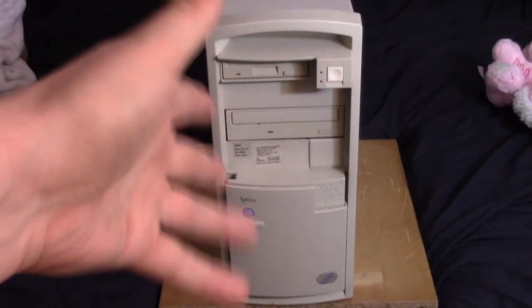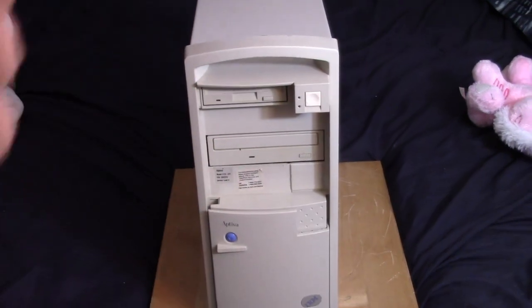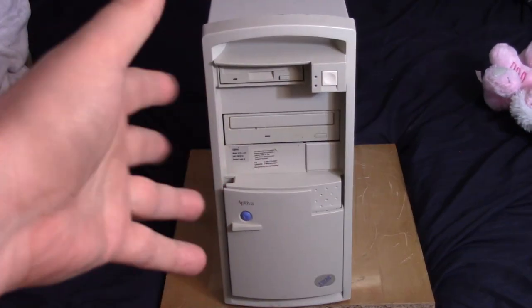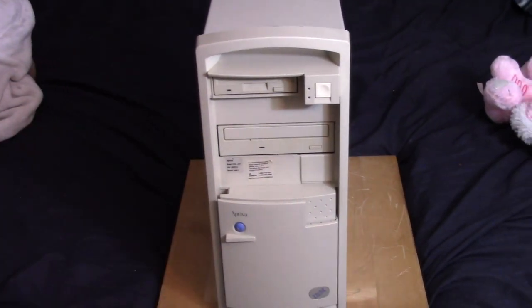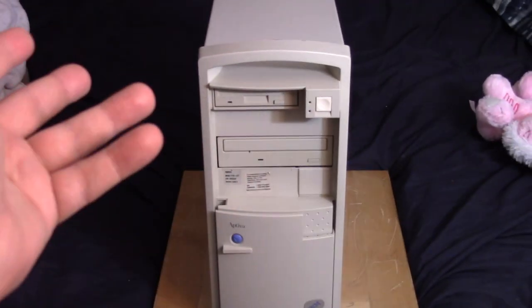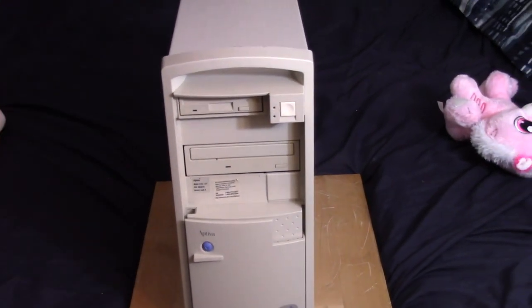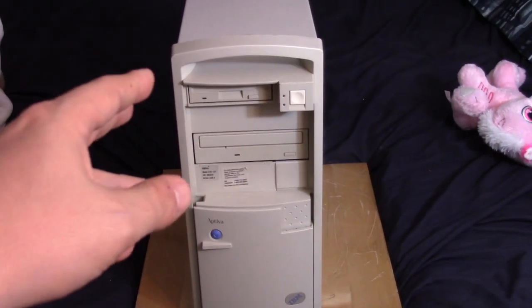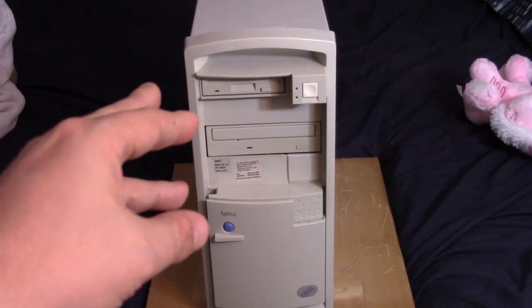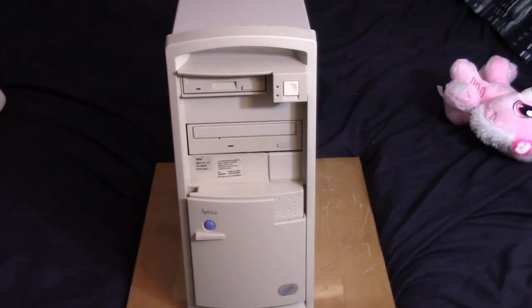As for the M-Wave, the Dolphin card in there, it wasn't as bad as I thought it would be. I know I couldn't get it working in pure DOS, but I'm sure it can be made to work in pure DOS. Still, there's just a lot of better options. I think probably most users had issues with it because they were using it both as a modem and a sound card at the same time, and I guess that's where a lot of problems come in with that card, although it does seem to have issues just being a sound card or just being a modem.